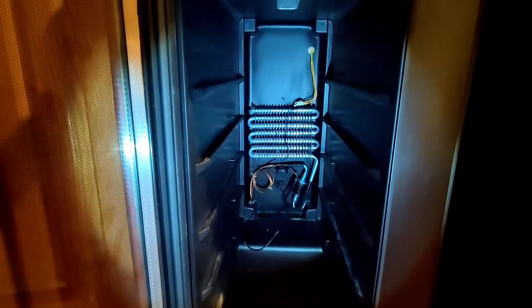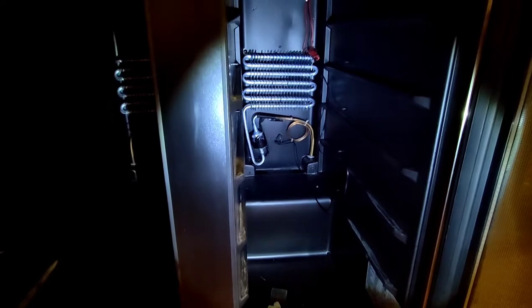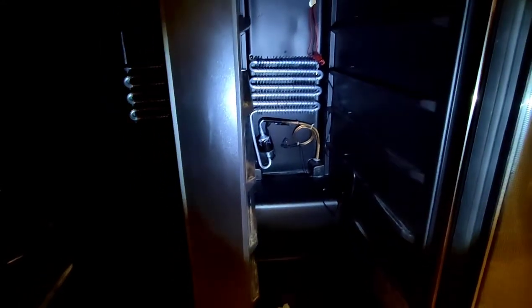You can look online and search for the owner's service manual for this. I've taken out the back panels of both sections — the red and white side — so you can see the evaporator coils, the high pressure line, the expansion valve on the lower left, and the same on the other side. I disconnected the connector at the top and I'm going to try to recharge the refrigerant. A professional came out and said this wine cooler should be trashed because it's not worth fixing, so I'm going to give it a try.